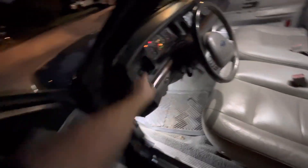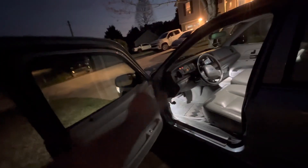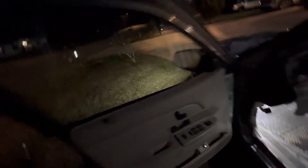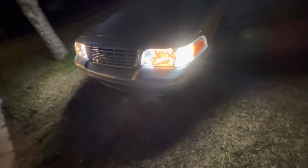All I had to do to get the LCM working was — I kept sitting there with the new headlight switch going back and forth. Sometimes if you do it enough it'll kick on, but I couldn't get the lights to work. So I had to get under there and tap the LCM with a ratchet. I also took the battery cable off to see if that would help, but it didn't. Eventually the lights came on.